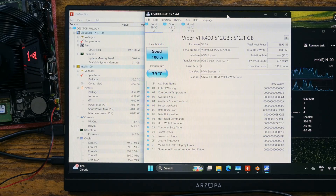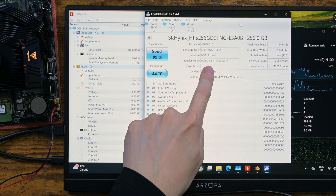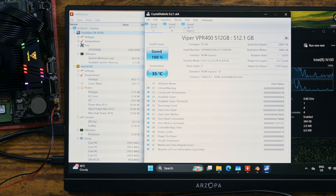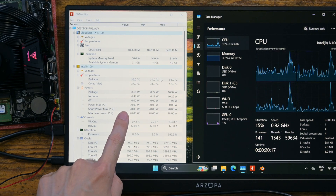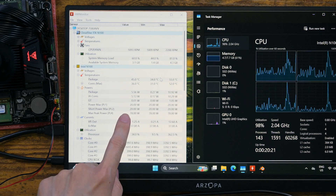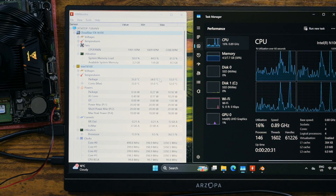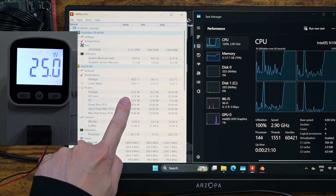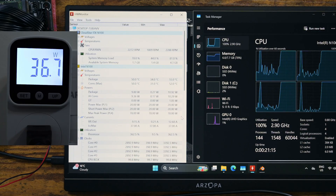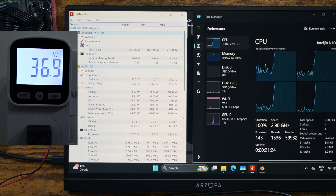As mentioned earlier, the two M.2 slots are PCIe 3.0 x2 and x1 lanes. The N100 CPU lacks the PCIe lanes to make it better — there is no way around it, which is why it's hard to find an N100 motherboard with two M.2. Additionally, no matter what I did in BIOS, I wasn't able to change the 20-watt PL1 power limit. Interestingly, the CPU itself seems to be hard-locked at 10 watts maximum, because even during rendering it didn't go over 11 watts. Power consumption was within expectation, with one caveat: because N100 is not a powerful CPU, it was virtually impossible to have it idle with Windows 11. It was almost always above 10% usage, so I wasn't able to get a proper idle reading. I think it would be around 20 watts at idle with 37 watts at all cores pushing 100%.